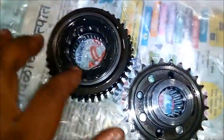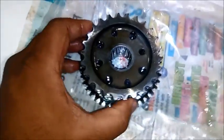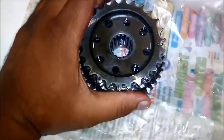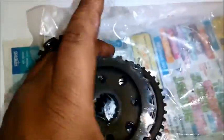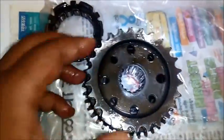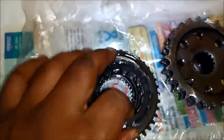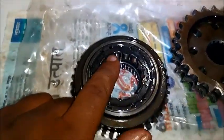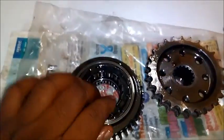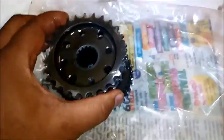It is better to change the whole unit. If you do not want the self-start unit inside your bike, the best option is to remove the bearing, place the sprag as-is, and use it directly without the bearing — this will not damage any other components. We have found broken bearings inside the clutch casing that damaged other spares. So the best approach is to either change the whole unit, disconnect the bearing, or just disconnect the drivetrain given for the starter. Thanks for watching, stay connected.